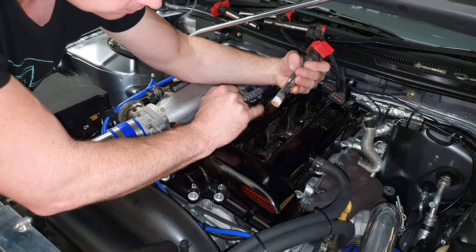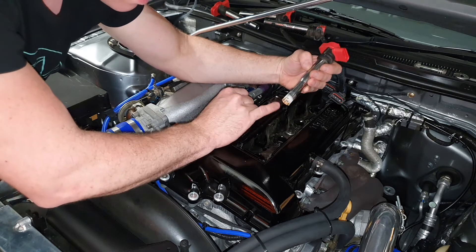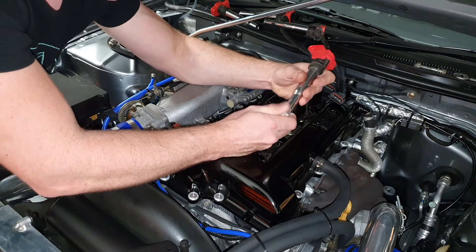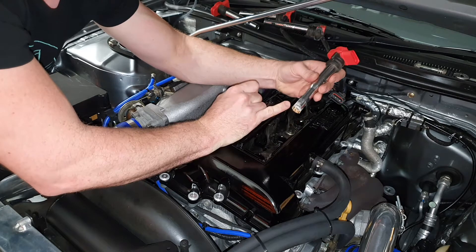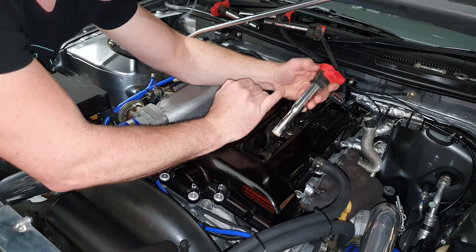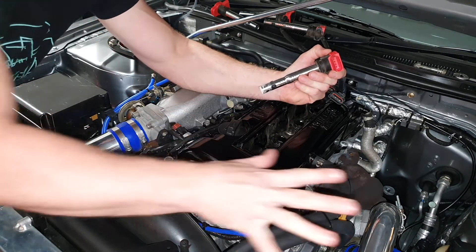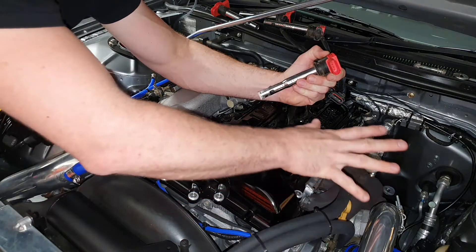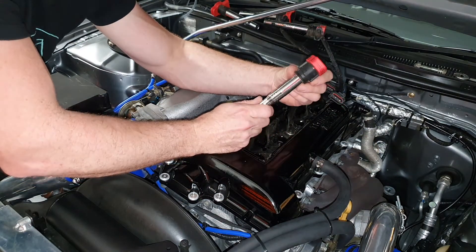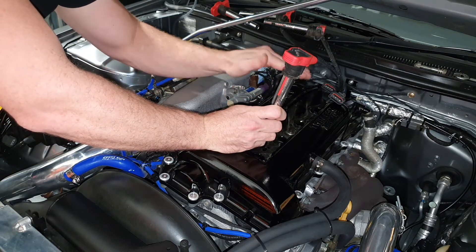There's a little bit of rusting around the outside there — that just shows signs that a little bit of water's gotten in. Not a good thing; ideally we don't want that. So far I've not had any misfires, but just something to be wary of because these R8 coil packs don't have the sealing around the top. It's okay to use, but be very careful if you're going to wash your motor down — I have been guilty of splashing a little bit of water in there. There are some aftermarket kits you can buy that have seals and a plate across the top.